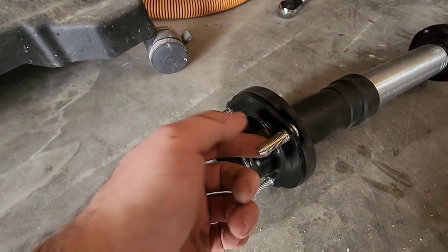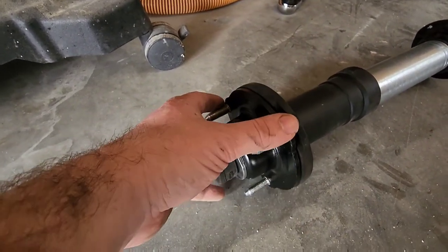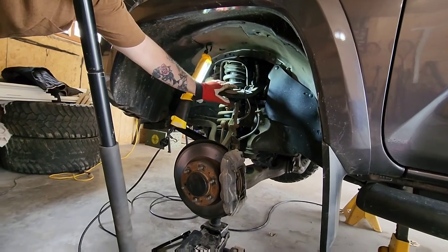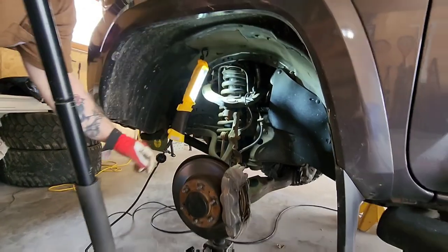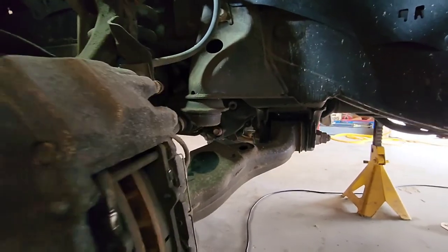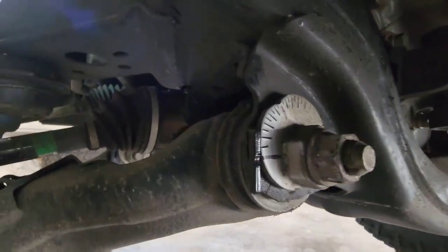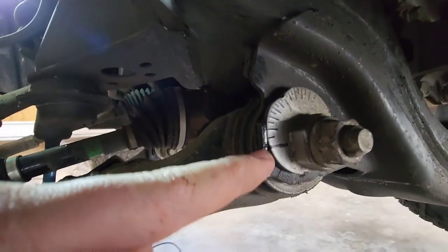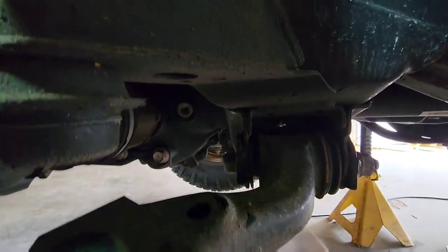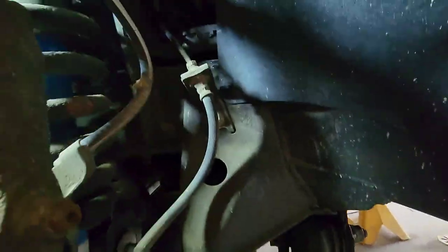He's going to use the stock nuts just because the ones that came with it seemed to be lower quality. So basically we're not reusing any of the OEM parts other than those three nuts. We've also taken out the bottom strut bolt and we marked the camber adjustments on the front and the rear so we can take it in for alignment after. You can see right there he's got the sharpie mark — he's got it marked on the front, and if you don't take the whole bolt out you only need to mark one side.